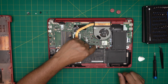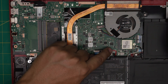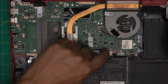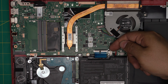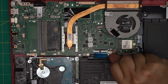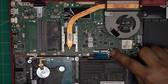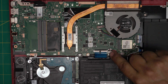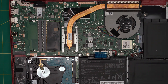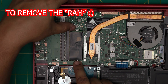But if you want to be extra safe, it's easy to disconnect the battery. Pull this trigger back with your finger — this metal cover — pull it back a little bit until it's over the white space. Then put your fingernail on each side and lift up, and the battery will get disconnected. To put it back, lay it straight over, push it down toward the motherboard, and push the lock over the jack.